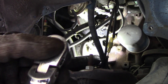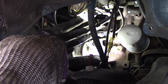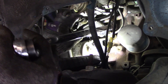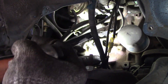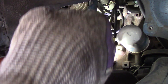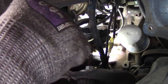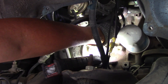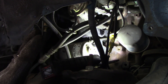Make sure the open wrench turns counterclockwise to loosen. As you can see, it's a 17mm bolt. But keep in mind — even if the repair manual says 17mm, sometimes someone may have previously damaged the bolt and changed it to a different size, so always verify your tool fits before turning. Okay, I got it — it's not too tight. Let me try to spin it by hand. Be careful on older vehicles. Yeah, it's loose now, and you can see the fuel starting to drip out.